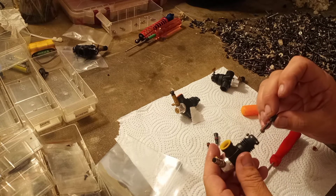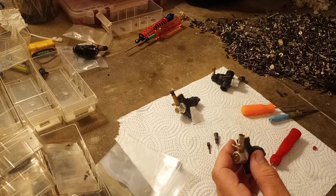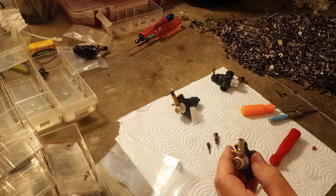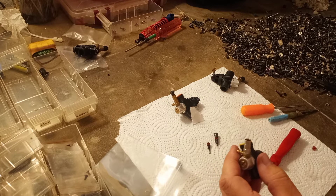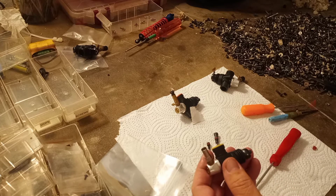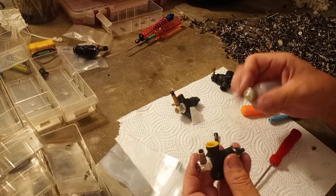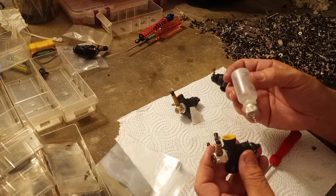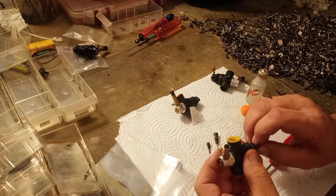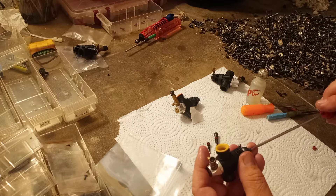Always coat them on the way in. Touch it and give it a spin. Something I also like to do: I take a light machine oil and add a drop to the low needle threads. They can get rusty. I always like to throw a drop of machine oil on those low-end threads.